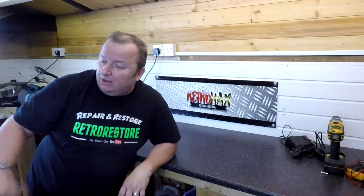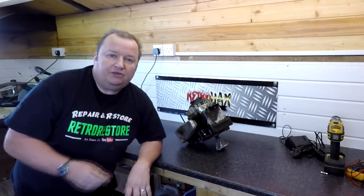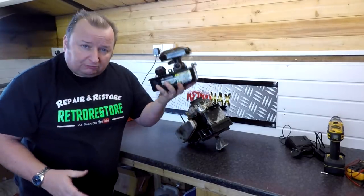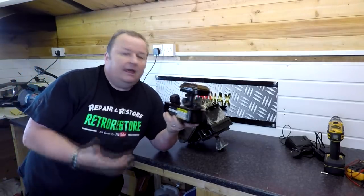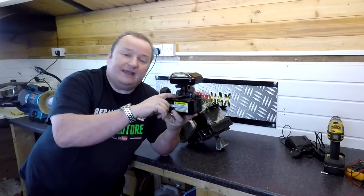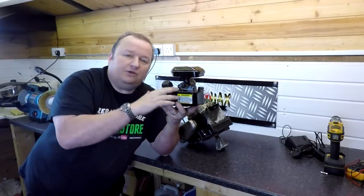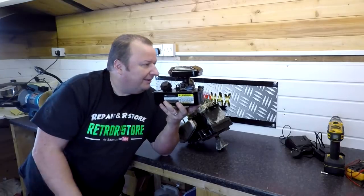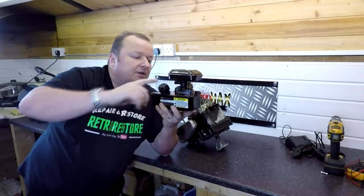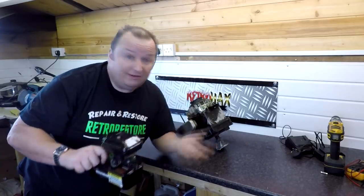I'm going to be doing a lot more on the Retro Hacks channel. Lots of people have been asking about the Trotter mower — yes, this is it. I've stripped these down hundreds and hundreds of times. It's only when I watched the video back that I realised I put the gasket and diaphragm on the wrong way. So just to clarify: you lay the diaphragm on the tank first, then put the gasket on, then put the carburettor on — that's the way it should be. Diaphragm first, gasket second, then the carb on top and bolt it down.